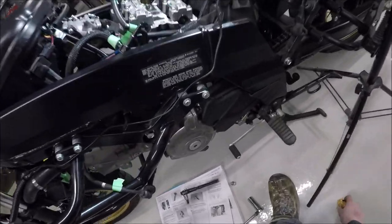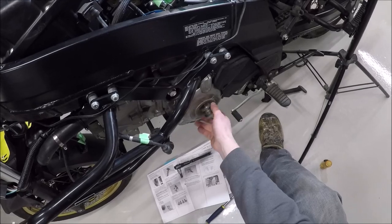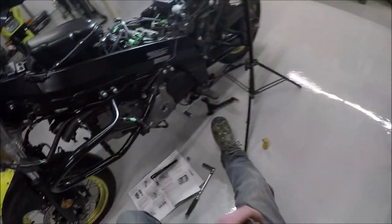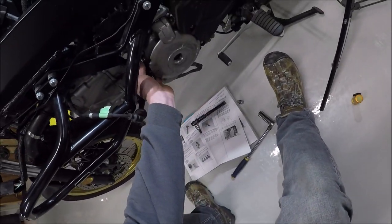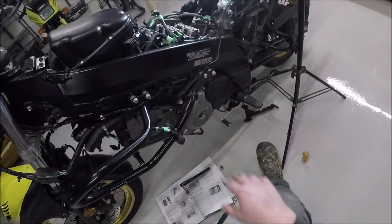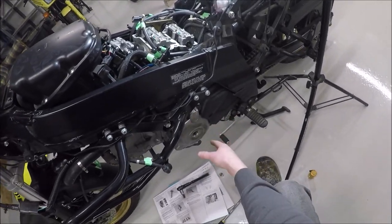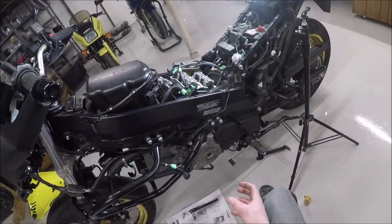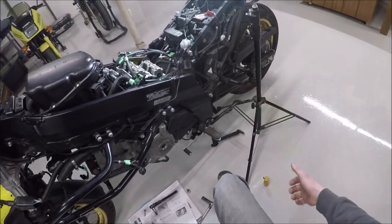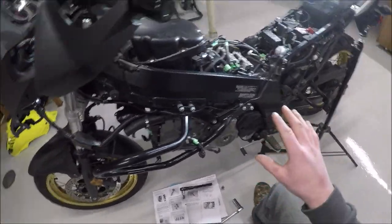In order to rotate the engine, we need to get the sight port out and then the crank port out. The crank port is a 10 millimeter with an O-ring, and the sight port is an 8. You can get around having to do this — on an SV or DL it's so easy it makes sense to just pull it off. Some bikes you have to pull the whole side cover off, in which case you can put it in gear with spark plugs out and rotate the wheel to spin the motor. But it's way easier on this bike because of the access.